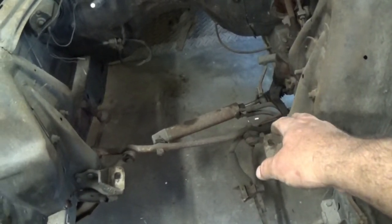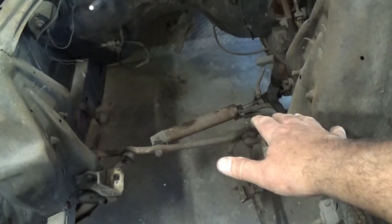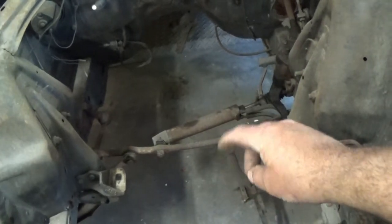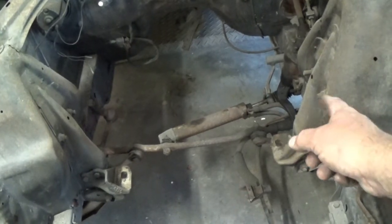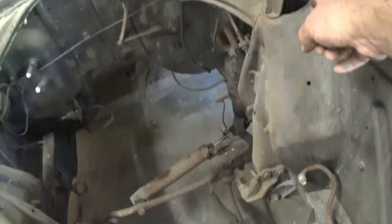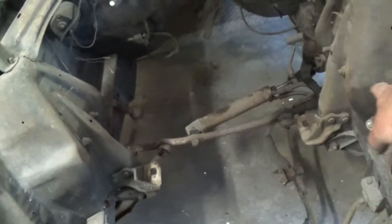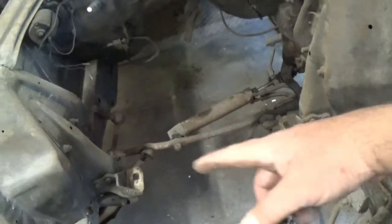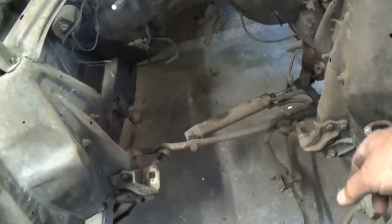I've made a couple of kits that bolted into the stock suspension, that worked well. I've also built a couple of strut suspension kits for these style cars, which still uses the shock tower but trims it way down. You can take a lot of material out of the shock tower, the hats for the strut and everything mount on top. And it's got like a K-member, almost like a Mustang, with a Mustang rack, but the control arms and all bolt in similar to the stock ones here, but they were all tubular stuff that tied in.